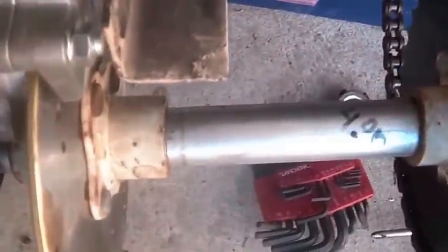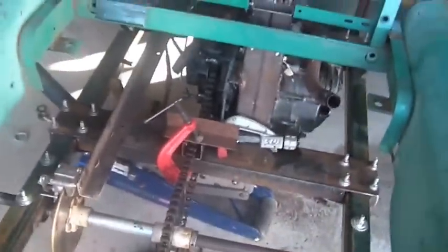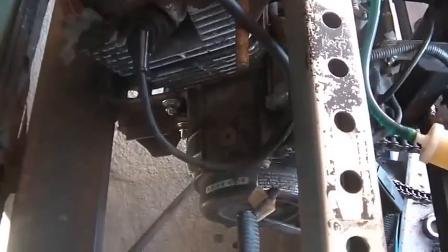I'm showing you guys, I don't know, perhaps too many details on this as I'm putting it together, but there's a lot to think about, a lot of considerations. Some of the stuff I have trouble with, like this bar is going to come down and have trouble hitting the frame. Just little things. Should you use this type of disc brake? It kind of tells you you wanna look. I would be bolting it there and there. It runs parallel to the frame, which would get me a little more strength. Given that this thing is tied on 2 points, it would be stronger. So, that's kind of what I'm thinking there. I'm debating whether to drill and tap this or bolt through. I'll probably bolt through. That'd give me the strongest hold.